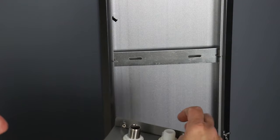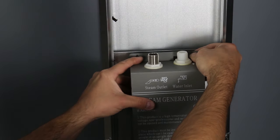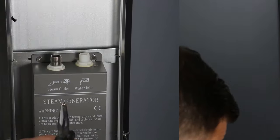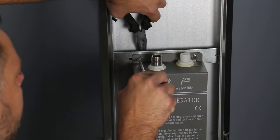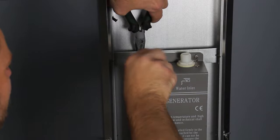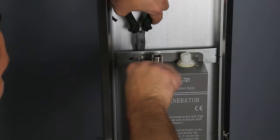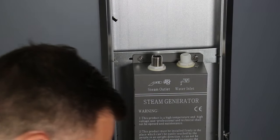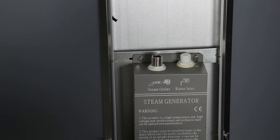To replace the generator, place the two bolts in the top of the generator and through the fixing bracket so it hangs securely. Take a nut in the long nose pliers, align it from the rear and screw the bolt into position. Only tighten about halfway so you have maneuverability with the bottom connections. Do this for both top bolts.